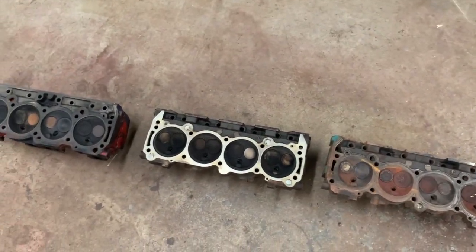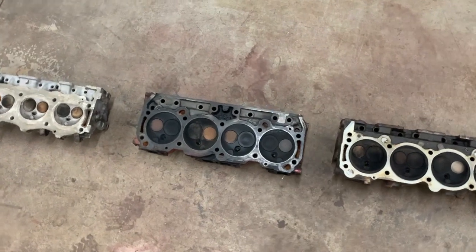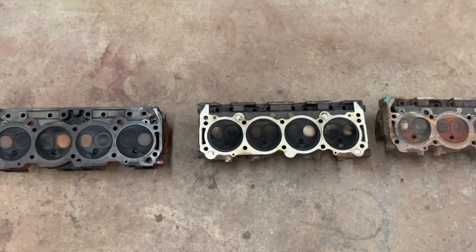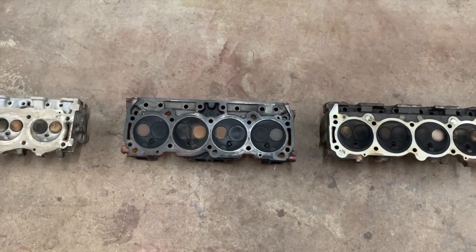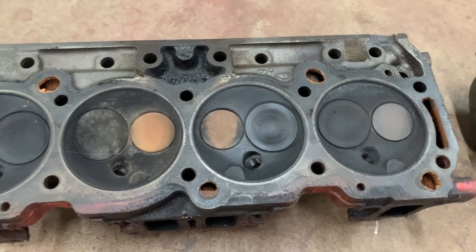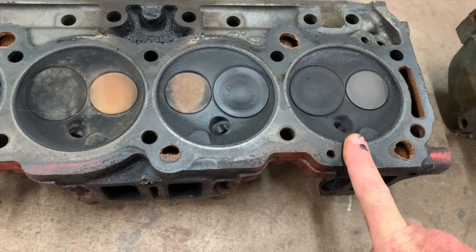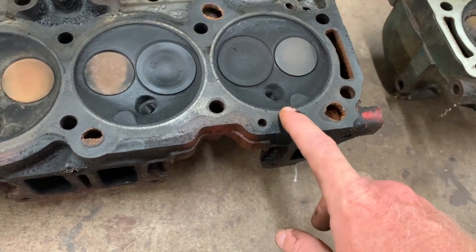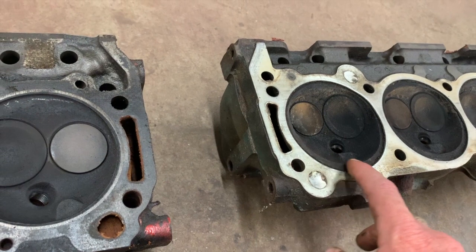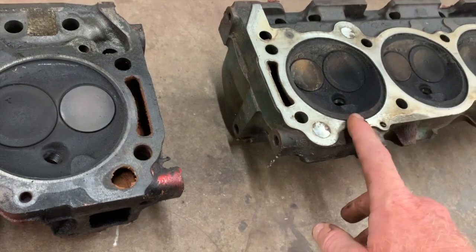And pretty soon I will have that set of 350 Buick heads from 69 sitting on a 300 engine. And we're going to find out what kind of power difference it makes in comparison to these 300 cylinder heads. I'm going to actually CC all these in the next video, so everybody has an understanding of how big the chambers actually are. I do believe the 350 Buick here probably is king, just by looking at the way the chamber is. And I have measured them in the past at 58 cc. These 67 300 heads, I have measured at 54.5 cc.